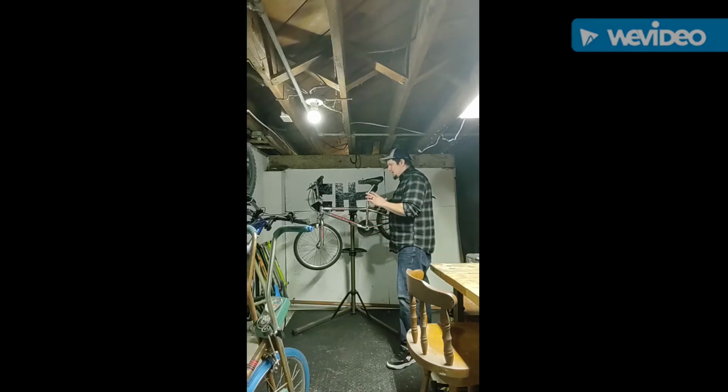Right after this bike, they came out with the Walmart, or the Wall Moose is what people would call them, or Wall Gooses, where Walmart bought into Mongoose and started producing the high production number bikes for Walmart. And they cheapened out. They started using aluminum and really cheap metals. This, on the other side, is 4130 chromoly tubing on the frame. Also, I believe it's in the bars.